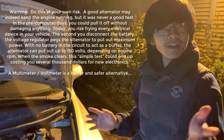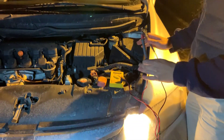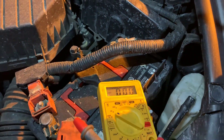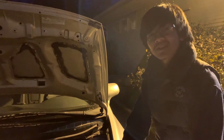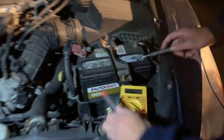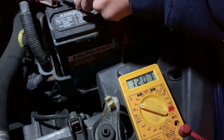Alright, I know I said no tools, but just for sake of reference — if you want to check and you have tools — using a multimeter, we can actually diagnose the problem. Using this 12-volt battery, if we put the points up to the terminals, we should get a reading of 14.4 volts if the alternator is working. You can see the reading is around 14.4 volts, and this is on a working alternator on the Honda Civic. But on the Honda Accord, if the alternator is not working, you see that it only reads 12 volts. However, keep in mind that that voltage is your battery — it could be lower if your battery isn't fully charged.